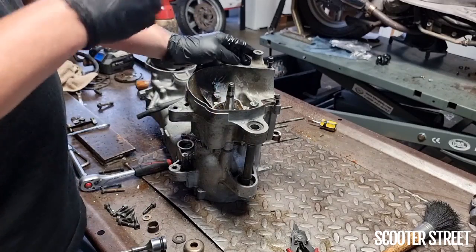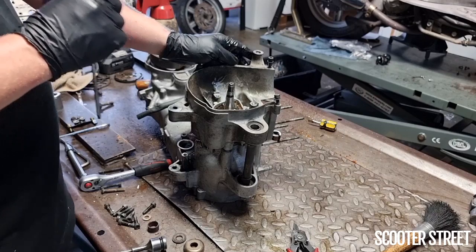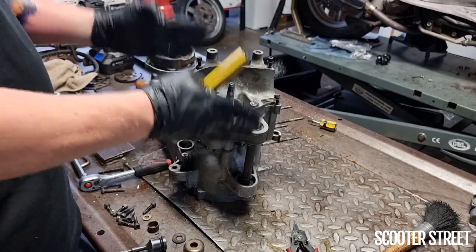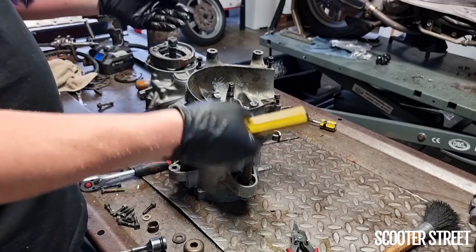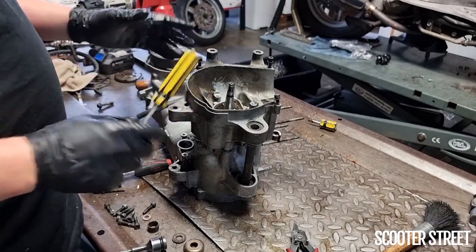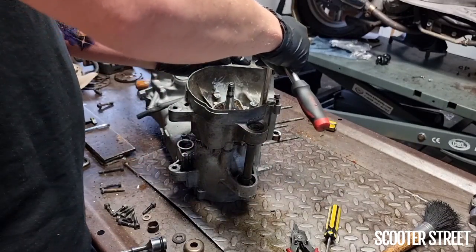So you'll tighten a couple of bolts, you'll notice it get a little bit tight, and then you'll go to tighten, say, the third or the fourth one in your rotation, and then it'll sort of loosen a little bit, just because the casing has slipped down that little bit more, and it'll continue to step down until it's all the way seated. So I'm going to go ahead and continue doing these up. You'll probably hear that little noise in a moment.